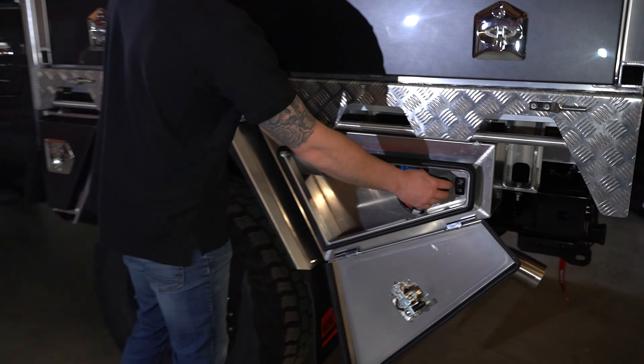Included in the package is full front and rear suspension. We've got the radius arms up the front, a brake upgrade which includes the Marks Full Drive Hydro Booster and braided brake lines, and the torque exhaust to work with the coil springs. That's a three and a half inch stainless DPF back exhaust system, and there's also a set of airbags inside the coils for added support if we've got a heavy load or if we're towing.